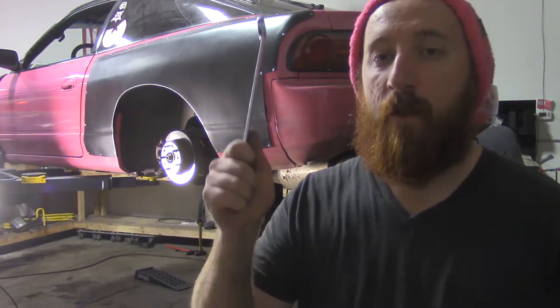When you're installing arms, on the knuckle side, don't over-tighten them if your car is lowered. Just snug them up, because when the car drops, it will tighten that up, and if it's over-tightened, it'll compress and it won't move freely.